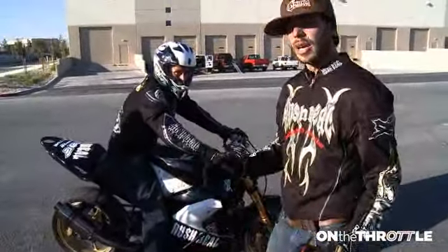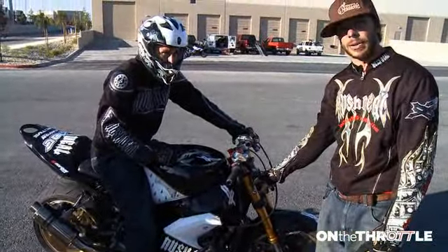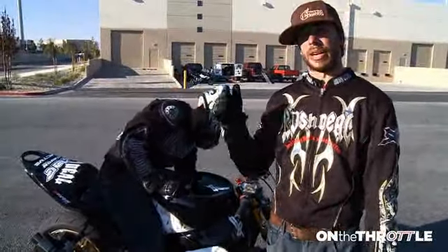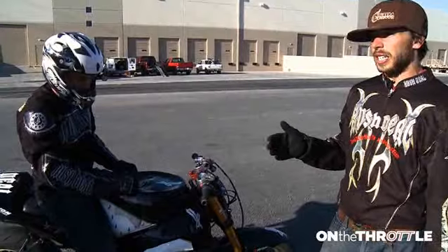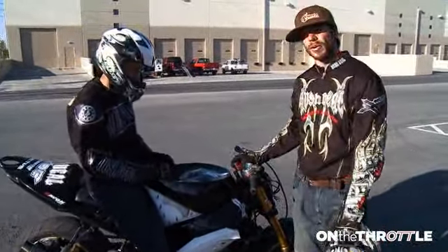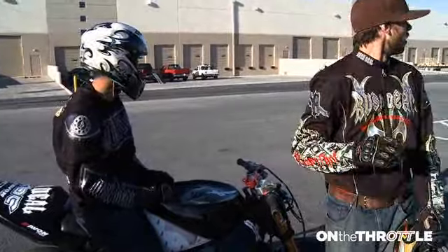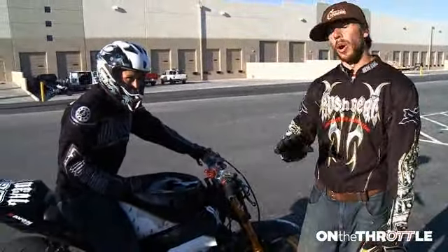Use a little bit of body English if the bike's really stubborn. This is a newer model Kawasaki 636 — it's an 04 with an updated front end from an 05-06 Kawasaki 636. You don't need to upgrade your front ends on most bikes. Conventional or inverted forks are just fine. If you have conventional forks, they're going to compress even more, which actually makes it easier to initiate the small baby endos. He does have a GPR stabilizer set at four. If you're going over 20 miles an hour trying to do an endo, it is not imperative but it's a great idea to have some type of stabilizer. I like GPR; Ohlins also makes a great one. The rod-and-piston style is fantastic. You have the ones that go on top of the triple, and you have the rod-and-piston type that sit in front. Either one is absolutely necessary if you're going over 30 miles an hour trying to do endos.